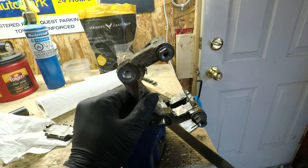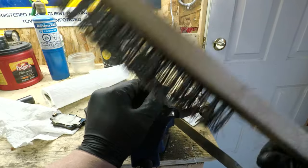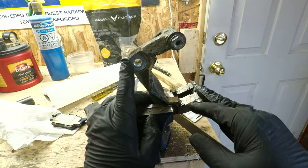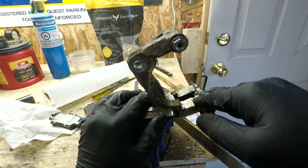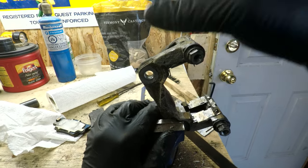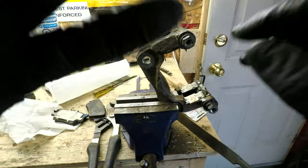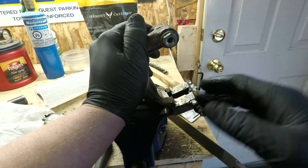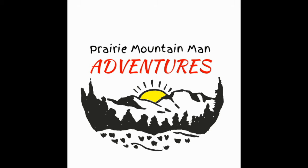Put a little bit of lube on here. Same thing — a little twist, and you'll see it gives a little springy spring where you actually twist them in. There you go. That is a properly serviced brake caliper. The only other thing I would do is take this wire brush, go to the caliper, clean it up, and put a tiny bit of lube on all the contact surfaces. If you're lost to this point and have no idea how to even take your brakes apart, I'd probably just not do that job. It is simple, but if you mess it up, it is your brakes. I'm not doing this content all the time, but I will share little things like this because this is such a simple job that gets overlooked. Thanks for watching — I hope this really helps somebody out and helps you extend the life of your brakes. Thanks for watching, and we'll catch you guys on the next video. Next video is not going to be automotive related at all.